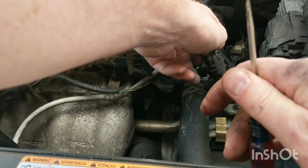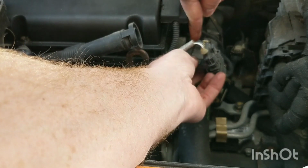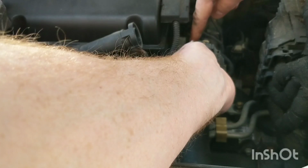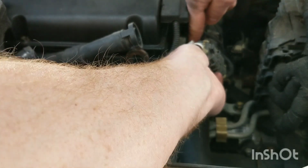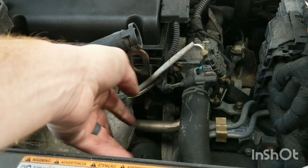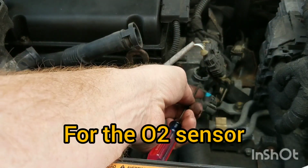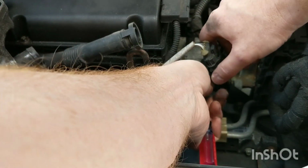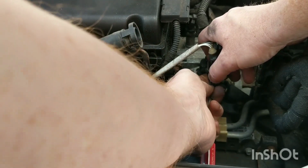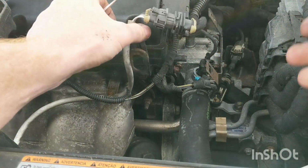Okay, there's a couple connectors here we can pull off just to get out of the way. This camshaft position sensor, I think this gray part comes unlocked, I believe. There we go. That insulation is just crumbling there. Hopefully it doesn't cause issues later. This connector here will actually pull out of the bracket. So take a screwdriver in the back, push down 1 finger at a time from the top and bottom, and then pull it out like that. We can leave it connected for now, just out of the way.